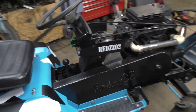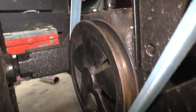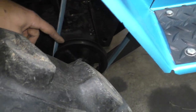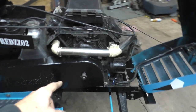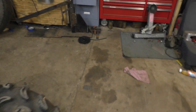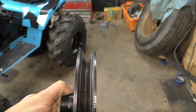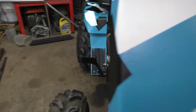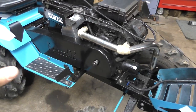The last upgrade I did: I wanted to put a 5/8" belt on this. You can see how deep this pulley is. The half-inch belt slips in that pulley — I didn't have any issues with the way I had it set up before because I had a smaller pulley on the engine. This is the pulley that was on it — a 6.5-inch — and the V-groove is not deep enough to handle a 5/8" belt, so it would not disengage the belt. Now we've got a 5.5-inch pulley under there, and I'm gonna pull this cover off and show you how that all works.